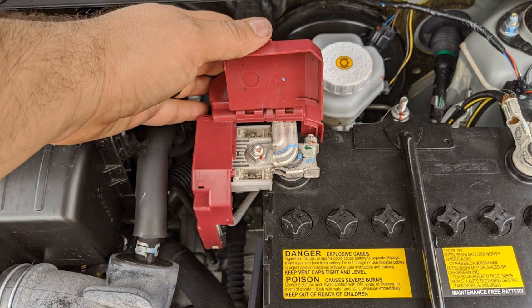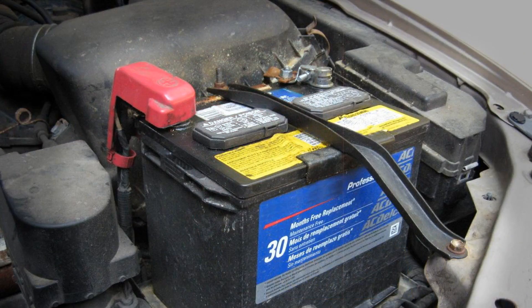How to check the electrolyte level. There are two ways to check the electrolyte level in a maintenance-free battery: by the marks on the design and by the indicators. The abbreviations MAX and MIN tell you the charge level; they are written in the window provided for this purpose. The indicator in the middle of the window tells the owner that the battery is fully charged. Sometimes there is no window, but the manufacturer leaves a transparent part of the case, usually made of plastic, for this determination.